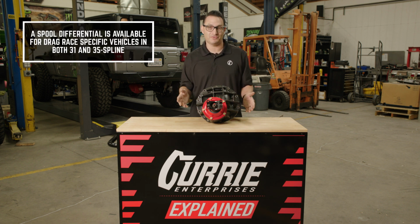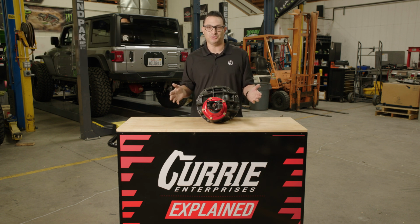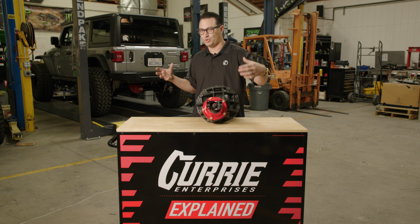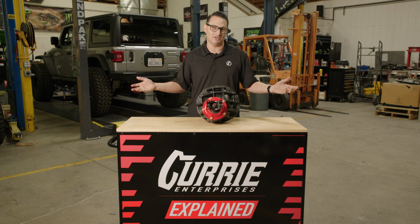If you guys are going to be drag racing, spools are also available in 31 spline and 35 spline. That's really the best place to run a spool. I don't recommend running a spool on the street only because it puts a lot of stress on the axle shafts as it's going around a corner because it just doesn't let it smoothly slip throughout the corner. You're kind of dragging that axle shaft. Puts a lot of unnecessary stress on it.